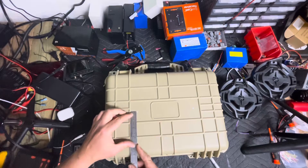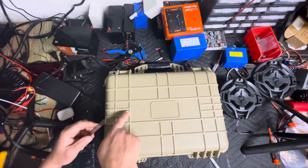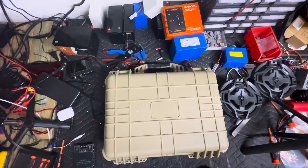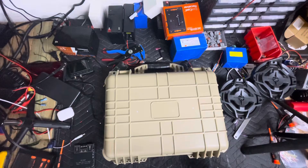To give you all a reference, it's going to be roughly about an inch and a half from the bottom of this rib, and one inch from the side of this rib — so from the inside over one inch, and an inch and a half from this side up. Now depending on the speakers, that will determine what hole size bit you actually need. It could be three, four and three-quarters, five and a quarter, five and three-quarters, six — it just depends on what speakers you're using. And once you start building these you'll learn that a lot of the speakers actually take the same hole saw.